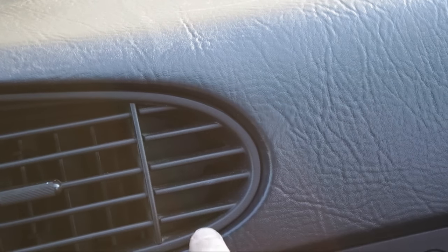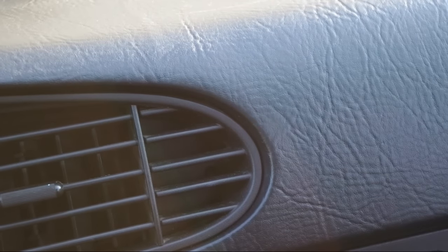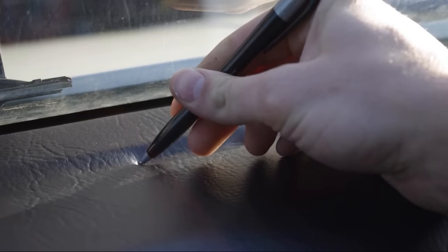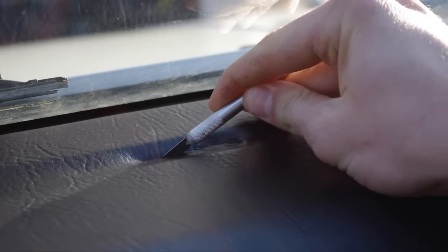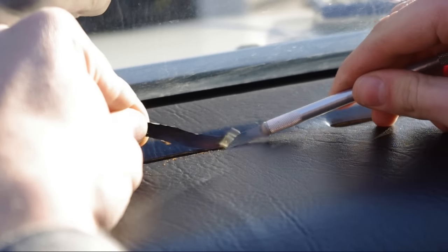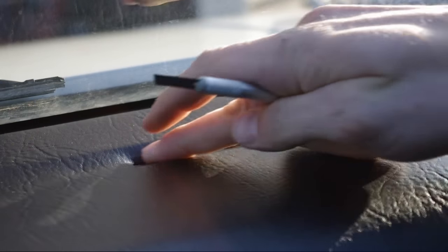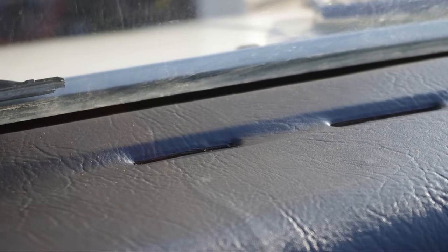All the fit and finish comes naturally when you put the plastics back together on most of these dashes. Now I have to go to the top and cut holes in the vinyl for where the air comes out for the defroster vents. I'm taking the heat gun again and softening up the vinyl so I can push down above the openings in the dash, press an outline into the vinyl, mark it with a pen, and cut it out. Press it down and the contact cement holds it even more. Do that all the way across the top of your dash and you have your defroster vents.